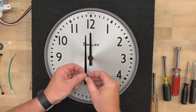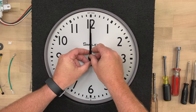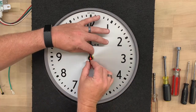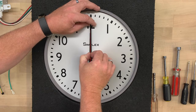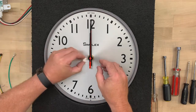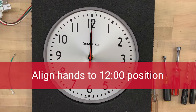Repeat the same steps with the remaining two hands. Align the hand to 12 o'clock as best you can. Check to make sure the hands are evenly spaced and not touching each other. If they aren't, slightly bend the hands, but you shouldn't need much adjustment. You can look down the edge of the clock to check. Each of the three hands should point toward 12 o'clock.